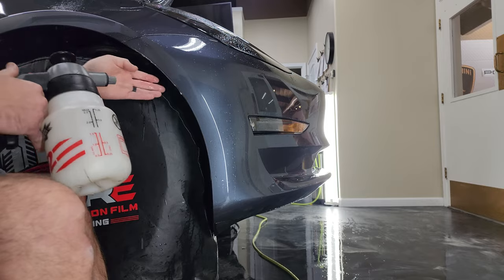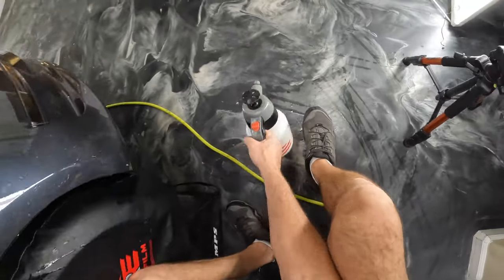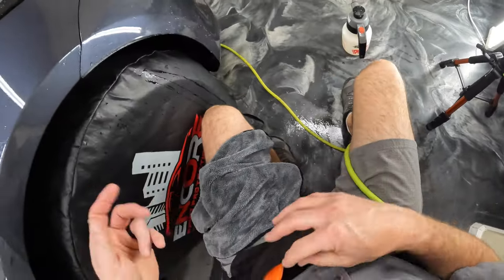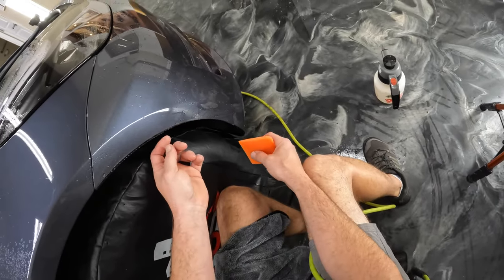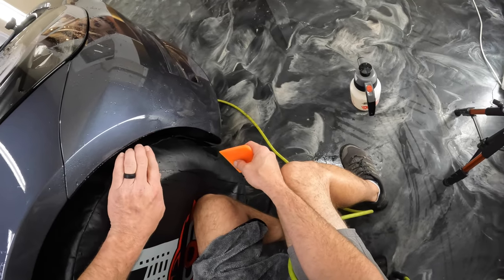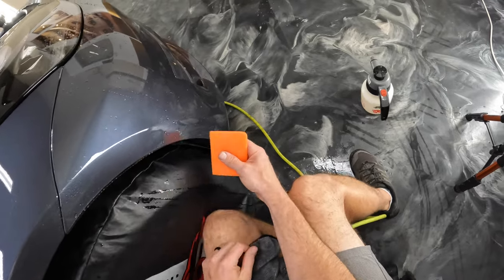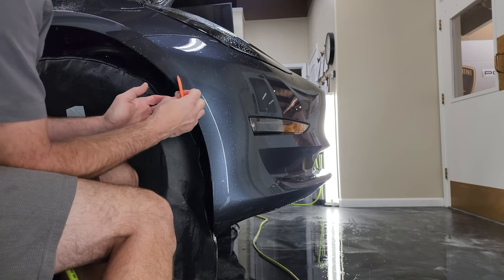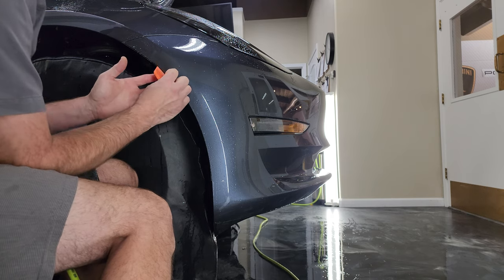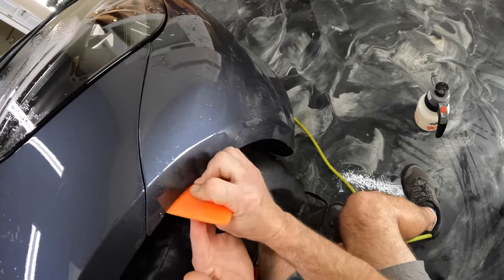Last one. Now, because this sat for a little bit, it was pretty dried out, so I'm going to put a little bit more alcohol on it. I don't like to wrap those over completely dry, because if you flip it over and you don't have really good consistent pressure, you leave a little air pocket in there, it's pretty sealed, and then you really have to pick the material up to get it back out. So I prefer just to add a little bit of moisture in there. I find it's easier to do it that way.